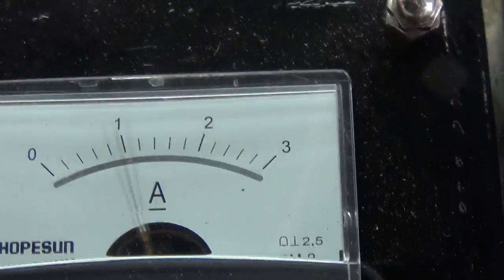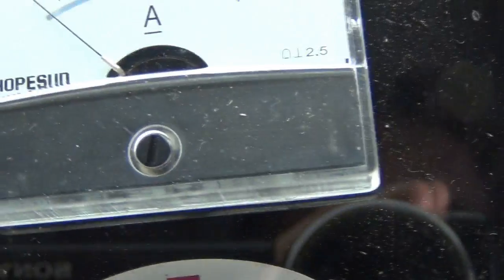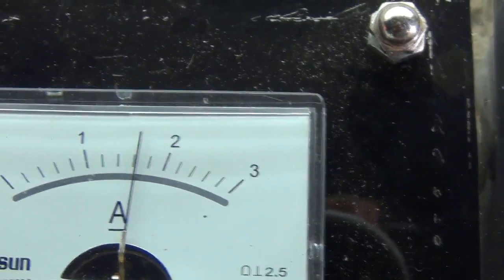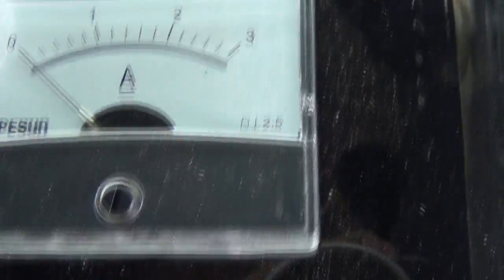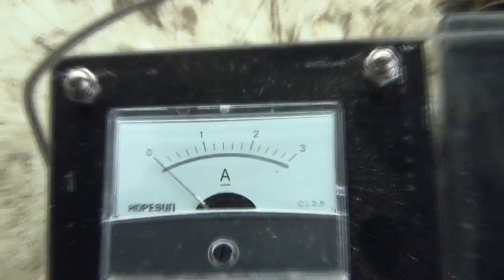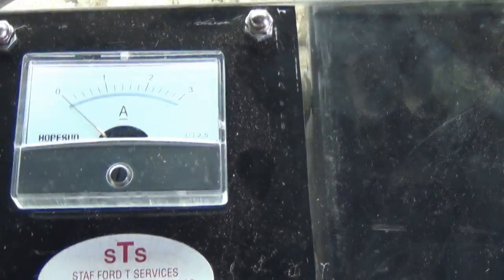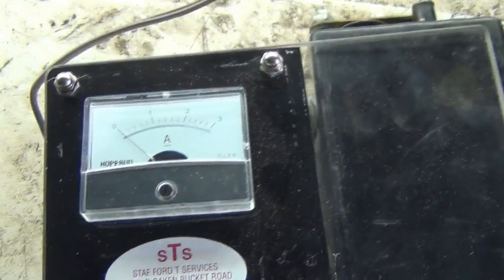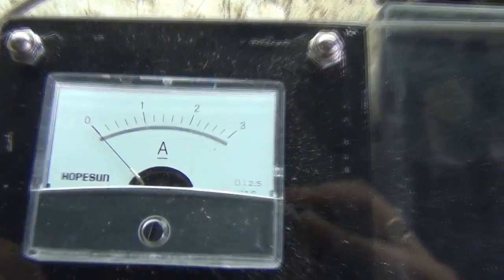You can see it sparks. And you can also see the current. That's probably a bit too much current on that one — it's reading about 1.8 amps, which is probably a little bit too much. It'll still work like that, but there is the possibility of double sparking, which you don't want, because then you end up with pre-ignition problems and things like that.